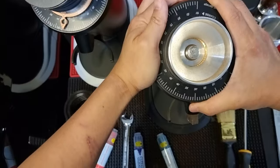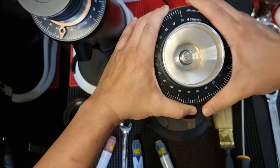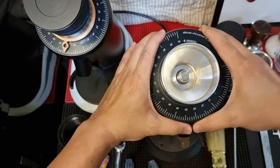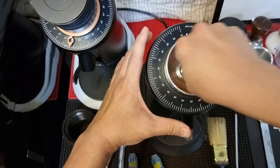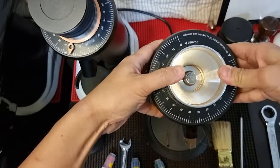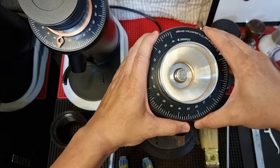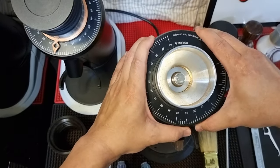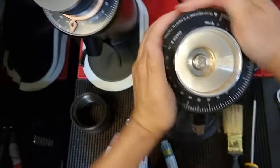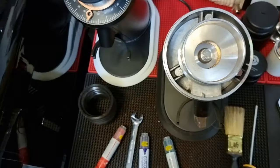Make sure the power is switched off. Use your thumb to try to turn — when it's tight, you won't be able to turn. You can feel that the center burr is free to spin. You can feel the burrs touching each other. Let's remove this. What we're trying to do now is see whether the initial alignment of the burr is done properly.